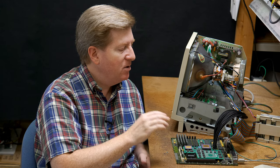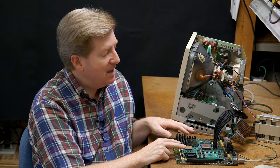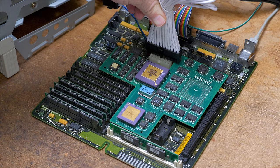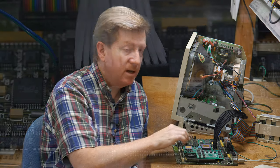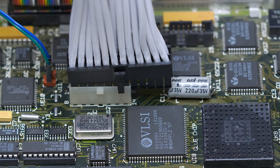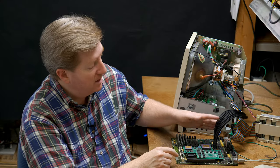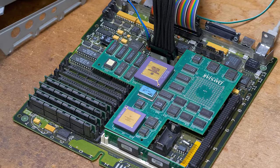Some people say you don't even need to cut off the cable — you can just slide it in. But as you can see, I've got a socketed upgrade, and in that case you're not going to be able to fit an uncut cable connector — that 24-pin, very wide connector — because the accelerator is in the way. Also, there are some variations of the SE30 motherboard where there's a component here that will interfere and prevent you from sliding it down. So what I did is I took the cable and cut off the portion I didn't need.